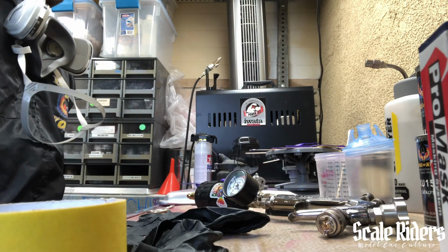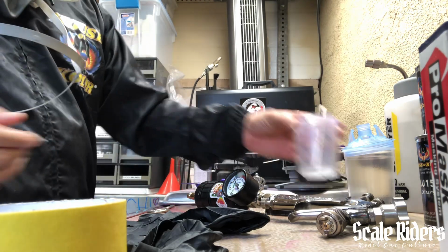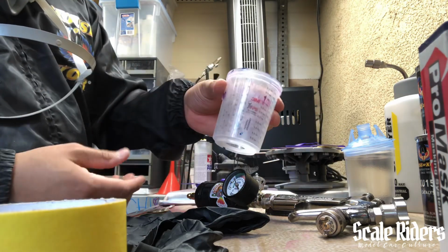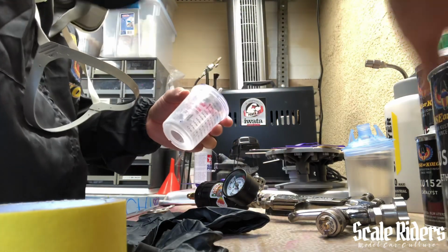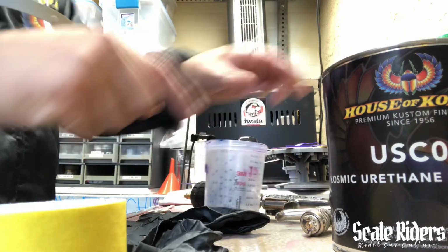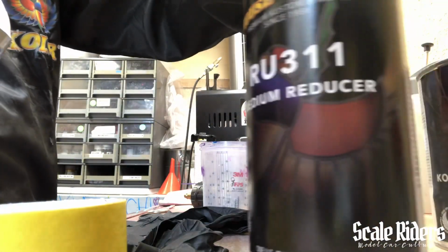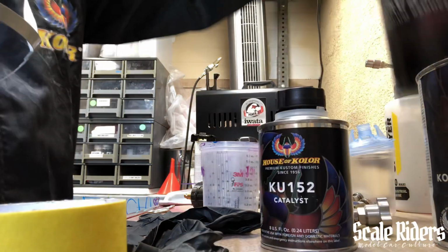All right guys, so we're pretty much ready, about to start. I'm gonna be rolling with the PPS cup. I'm gonna be doing 3-1-1. So I'm gonna add three parts clear, one part catalyst, and then one part reducer.